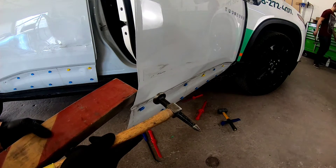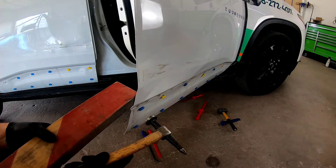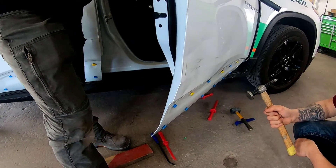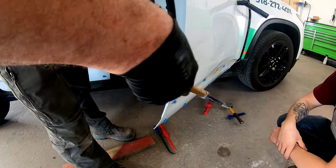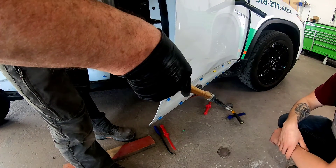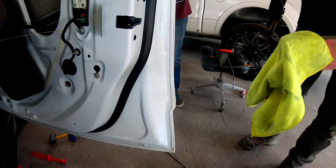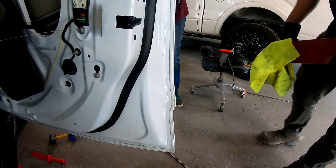I'm going to use just a 2x4 to straighten up this edge just a little bit. I'm using a 2x4 because it's soft and it's not going to mar up the inside of this door — I don't want to paint in there if I don't have to. I've got a pry bar inside this door and I'm working on pushing out the center of that dent. As I have pressure on it, I'm tapping down this edge trying to get that metal back into shape. Now I've got Darius holding the door while I take the 2x4 wrapped in a towel and give it a couple good whacks to straighten up the edge.